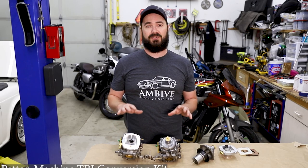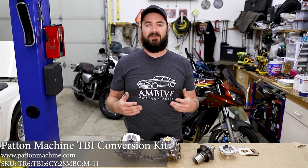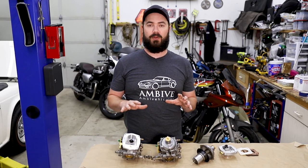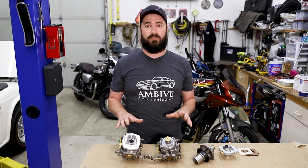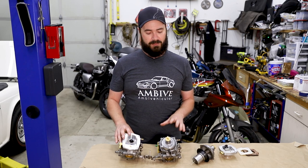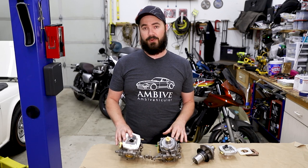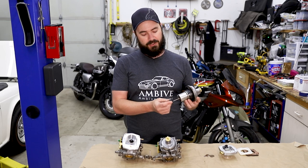Now this is the Patton's retrofit kit, also sold as the affordable EFI kit. It is essentially a throttle body retrofit that turns your carburetors into a throttle body fuel injection system with a relatively minimal number of complications. On the right we have a throttle body fuel injection system; on the left we have the carburetor still left behind. All that was required to convert this to a throttle body fuel injector was the removal of the top hat, the plunger, and the needle.